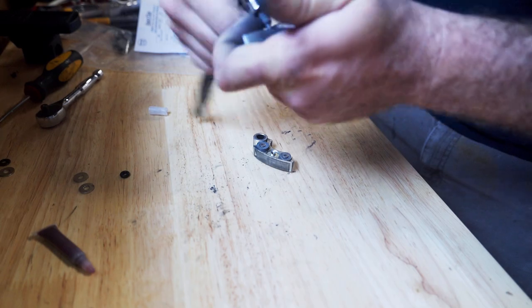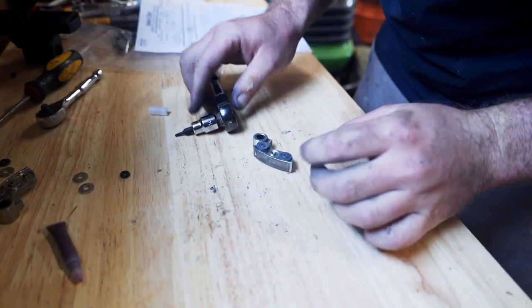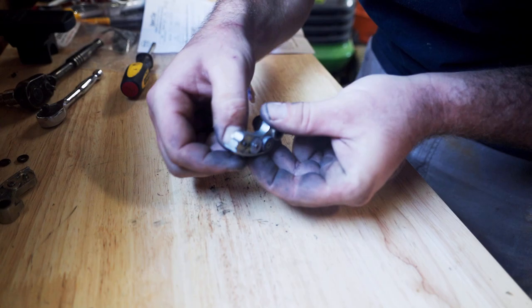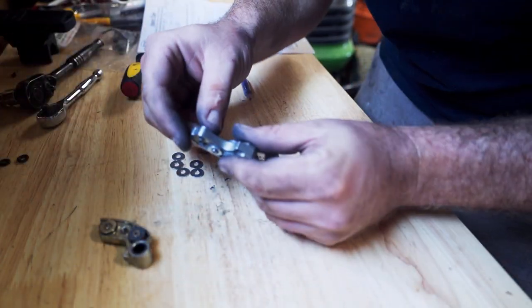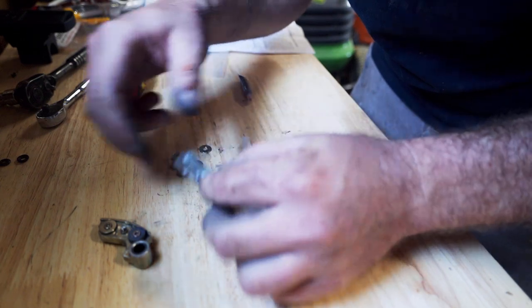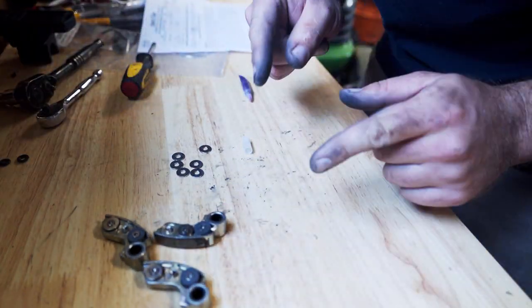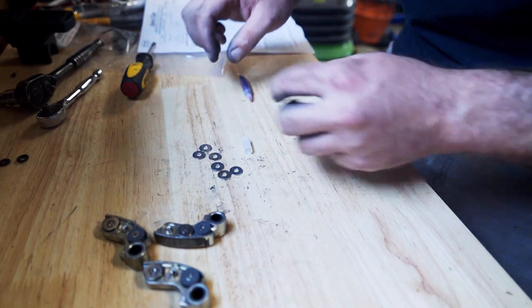Put her back in drive. I feel good about that — that's one done, we got two more to do. Just as a second check: we've got one spacer in the tip, two in the middle, tungsten weights on the bottom. One in the tip, two in the middle, two in the bottom — across all three. Good. And we have six total that we just removed — should be 600 RPM, putting it right at peak horsepower under load.